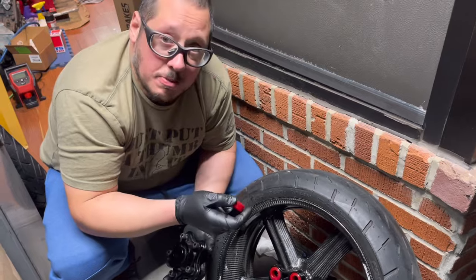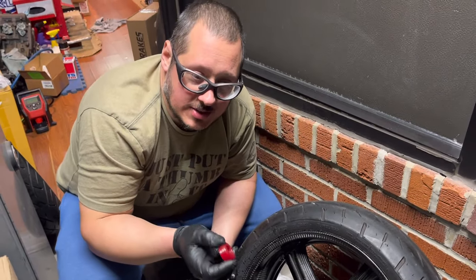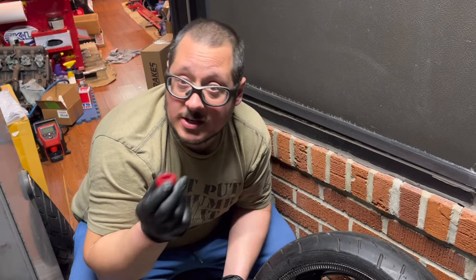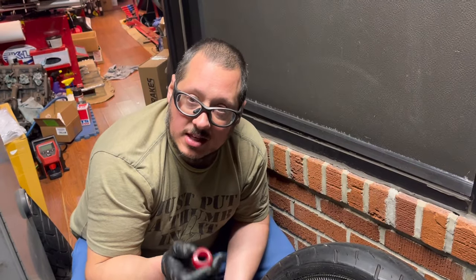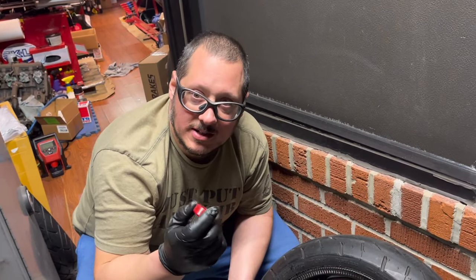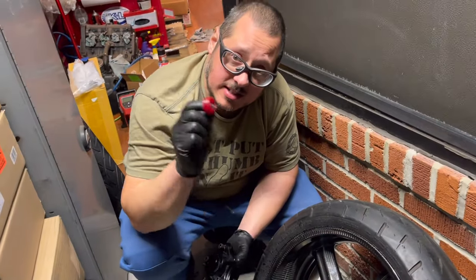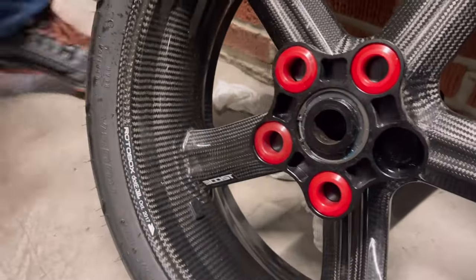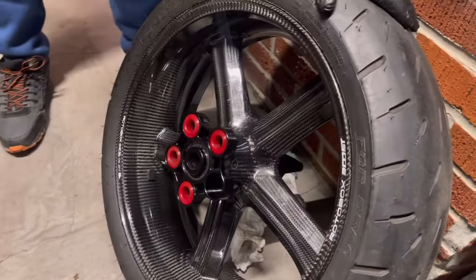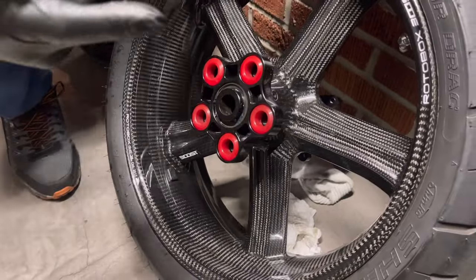So, when I got my Rotobox wheels, when Rotobox first came out, like 7 years ago or whatever, they used regular rubber bushings, cush drives. I ended up having to get a second set because they recommend it, because they wear out. So I bought a second set of rubber bushings just to have as a spare. I guess so many people were complaining that they wear out so fast, so they actually went with polyurethane. Polyurethane bushings last like 10 times longer than rubber. So that's a smart upgrade that they did. I like what they did there, because that was a known issue. But they did that later on, after the fact, probably because people were complaining that they were wearing out. So yeah, these are definitely polyurethane bushings.